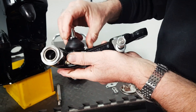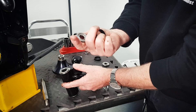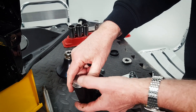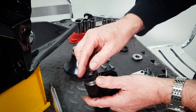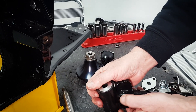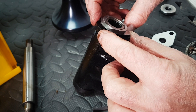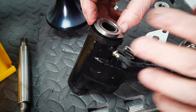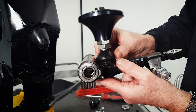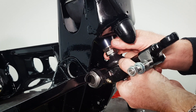What we've got here now is the ball joint fitted into the arm, new bearings in the arm, and the pivot pin for the shock absorber. We've got the rear washer — this is the oil seal washer — which goes on first, and then the oil grease retaining ring, which is a rubber ring that just pops on over the top. Once that one's in position, turn it over. The best thing to do is stretch the grease retaining oil seal ring over the arm to make it easy to get into position, then with the ball joint in and the grease retaining seal on the ball joint, flick everything into place.